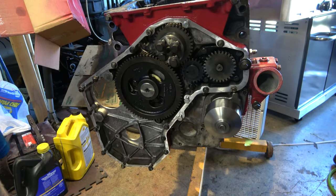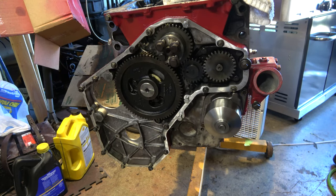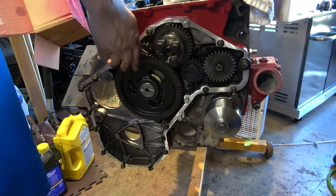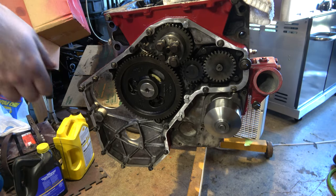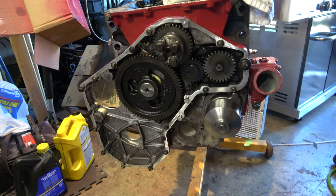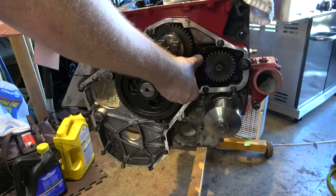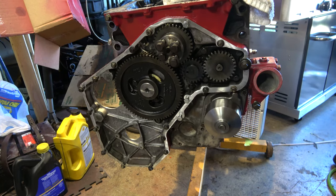We need to torque that down. Check the book, I think it's going to be 18. First of all, camshaft gear backlash, minimum is 3/1000ths and a maximum of 13/1000ths. That feels about right. Oil pump gear backlash is the same. That feels fine. Yep, as I suspected,